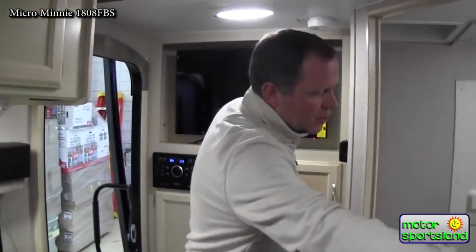One other thing on the trailer. Again, I try to hit on the unique things about this specific trailer. 7 feet wide. This is not an 8 foot wide trailer. So when you're towing this behind a half ton pickup truck or a mid-size SUV like a Jeep Cherokee, a 4Runner or something like that, it's pretty close to the width of your vehicle. So you don't need super wide mirrors sticking out, and it's gonna stay in that wind stream that your tow vehicle's created, and just have it a much easier towing experience for you.